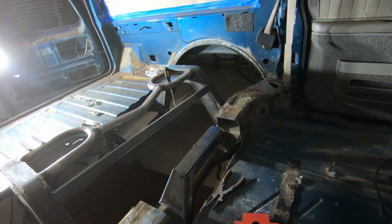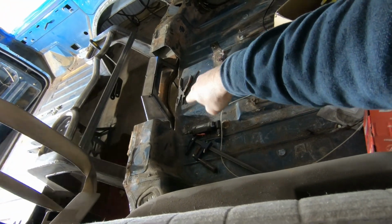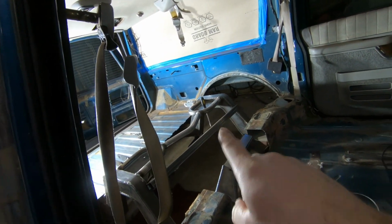Anyway. I'm gonna finish welding up the cross member. I'll cut the bottom piece out. I'll make the plates for the bottom, except I gotta weld the bottom of the bag mounts yet, and then I just wanna kinda smooth out the notches. I only ever welded them. I never actually went and ground a nice little radius in them. So we're gonna do that.